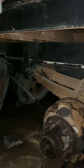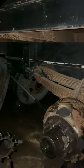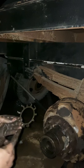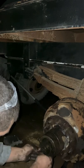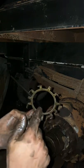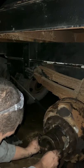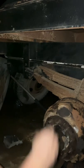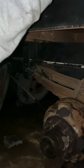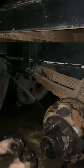Okay. So now it's time for this little keyway thing, and like one or two have broken off over the years. It looks like three. So remember to line up this little keyway with the keyway bottom. Oh yeah, we're in there good enough. And then here we go, the last axle nut.